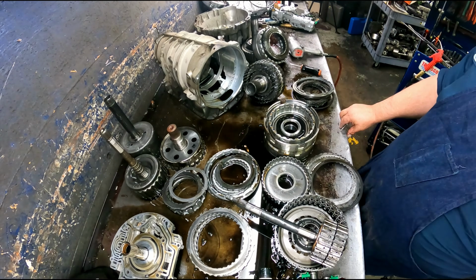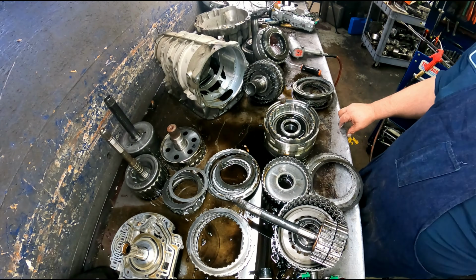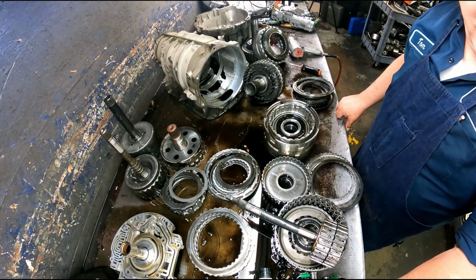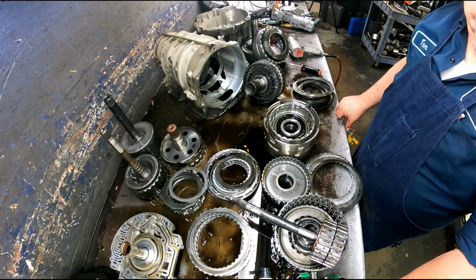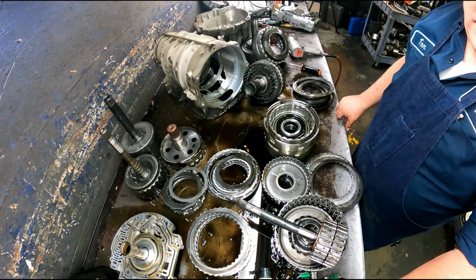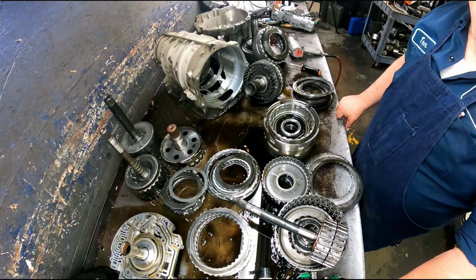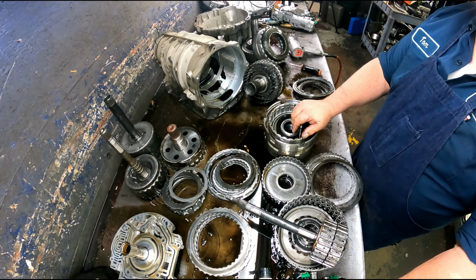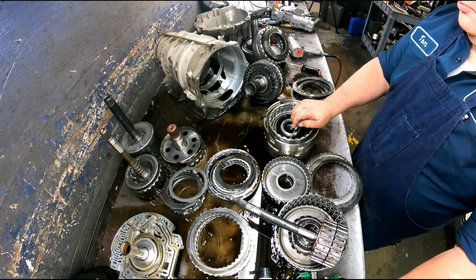Looks like we're probably going to, these always have an AFL valve that's always worn out in the valve body. Either ream it out and put the oversized valve in it, or get you a valve body for it. So I got the reamer kit, so we'll be putting the valve in there. The lockup solenoid, LS kit with pistons, filter, torque converter, bushing kit.